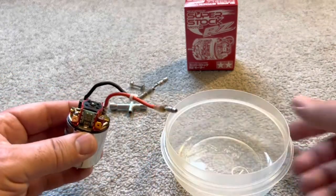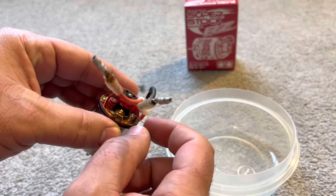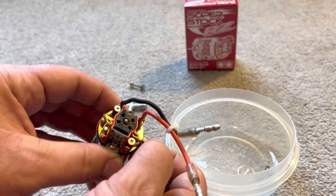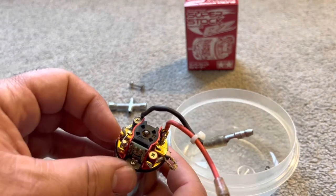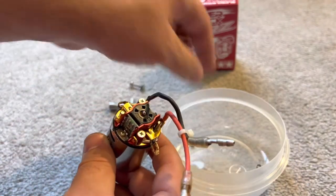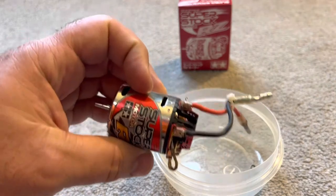Get yourself a bucket to put parts in. You want to release the brush spring — that's just going to come out like that, and I like to put it in the side. Pull these brushes out slightly. Do not touch the end of the brush where it makes contact with the armature, because you'll leave oils from your fingers on there. You can touch the other area — not a problem. Get the other spring out; left and right — don't mix them up.